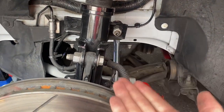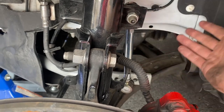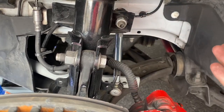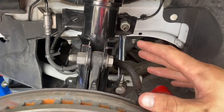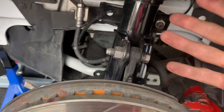What ends up happening is the car moves up and down, the sway bar moves as well, and it can cause it to hit other components within the car, making that weird sound you hear inside. When I first installed these with Joe, both bolts were tight up top and at the bottom. But once the suspension settles on the car, things can become loose over time, so you want to double-check them.